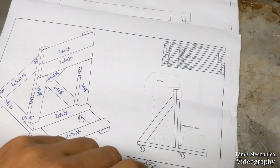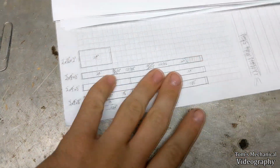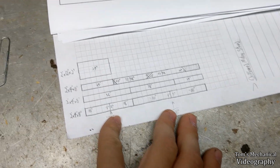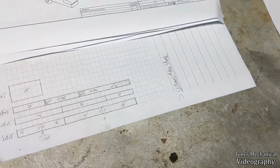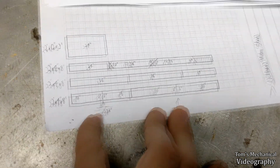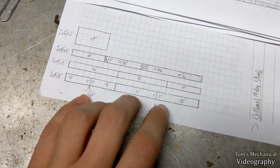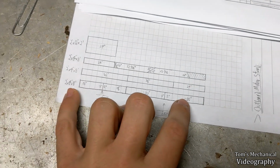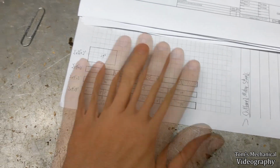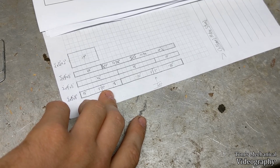But it also messes something up. Now, I went out here, and this is another thing I always do. I always plot out all the lumber and all the cuts onto graph paper. It's my own actual graph paper design that I made work in Excel. And this is where I noticed that deficiency: if you make these two boards 31, you can't cut it out of an 8-foot 2x4, because after you get everything else measured out, you end up with the board being 98 inches instead of 96.